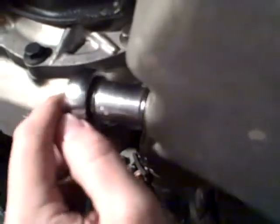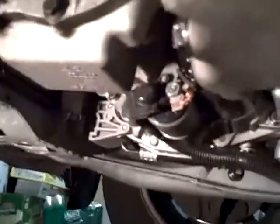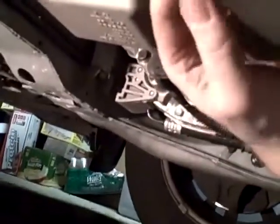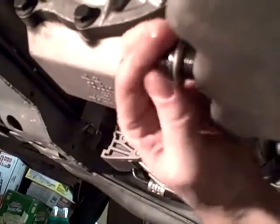Okay, for this next part, you need an 11/16 inch socket, right? And then I'm gonna try to loosen this guy up. There we go. Okay. Once it's loosened up, make sure you got your bucket in the way. Catch all this great oil as it comes smashing out. Just to be sure. Where is it going to go? It's a gusher.